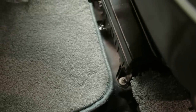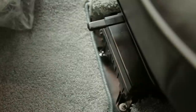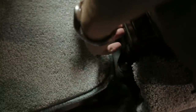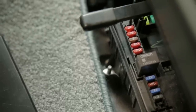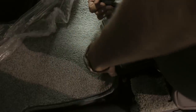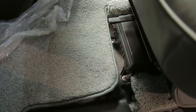The Chevrolet main fuse panel is located right below the driver's seat base. To access fuses, press the tabs on either side, lift the lid, move the seat rotation lever out of the way, and slide the cover off. Please refer to your Chevrolet owner's manual for fuse assignments. To replace the lid, slide the swivel handle over, slide the cover into the locking tabs, and press them down. Never leave fuses unprotected.